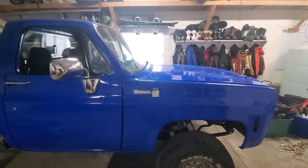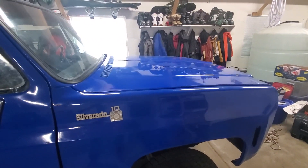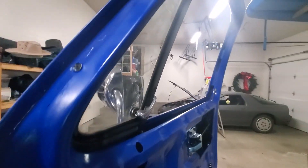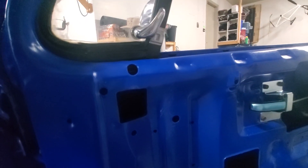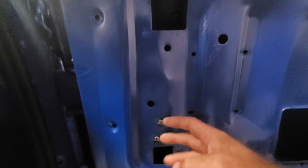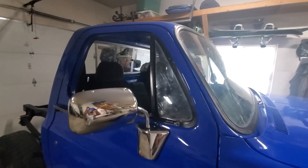And here we are back at the truck. Not only is the vent window installed — we'll look at how that mounts on there in just a minute — but the hood is also on. There's just a little bit of alignment work to be done there. The vent window installation went pretty clean. The primary mount points are right along the inside of the door: the screw, the screw, and then one right up here on top. That holds the vent window in position, and then the track — the channel that the main window runs in — goes down the inside of the door and mounts right here with these two quarter-inch bolts. And that's about it. It's working; we're happy with that. The weather stripping is all new, it looks pretty sharp, especially compared to what was in there — that old pile of rust. And that part of the project is done.